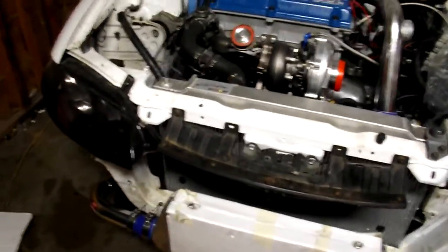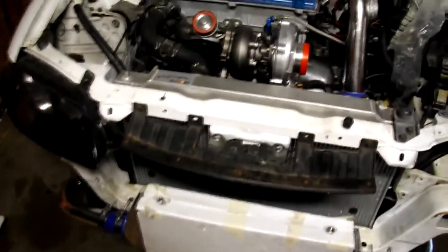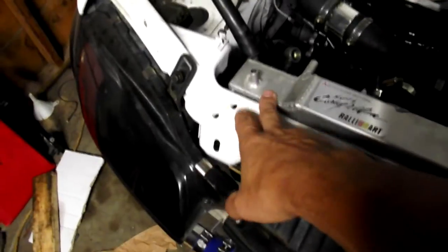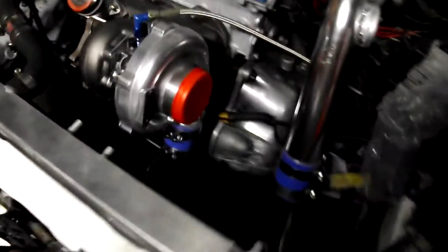The way that I got this to mount in here was actually not that bad. We haven't run a down pipe with it yet, which may show some concern — I'll show you why in a second. Let me give you a little preview of how to install this. As you can see, I only have one radiator mount holding this radiator on. On the bottom it has these same little pegs and they sit into the radiator supports at the bottom. I've cut the peg on this side off of the bottom, so the peg on that side is the only thing holding it in and it sits perfectly.